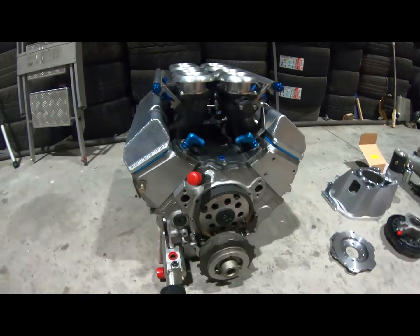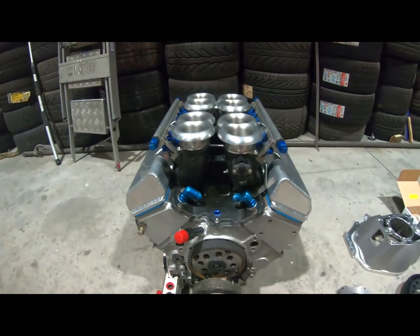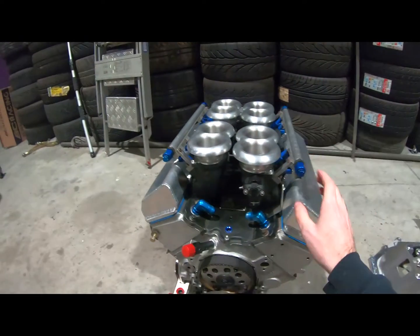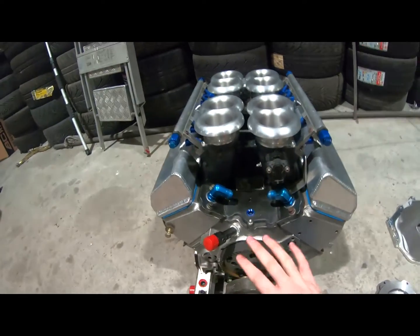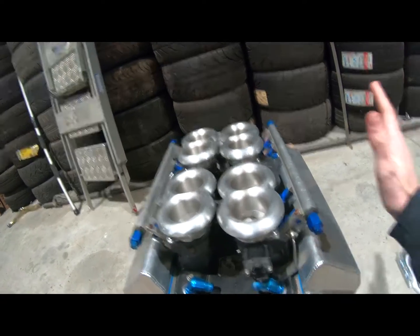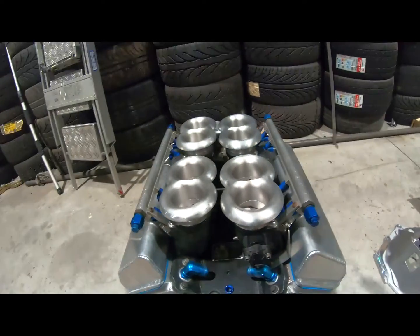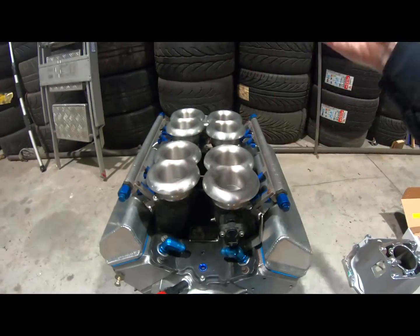This has what's called a 4/7 swap on it, which is an interesting kind of mad engine builder thing. Basically with the firing order of the V8, I think you only have maybe 3 possible firing orders on a V8. And then you get into like cross-plane cranks and stuff like that, but we won't get into that. Basically you have to fire 2 cylinders side by side at some stage in your firing order. Normally it fires them at the rear, which is the hottest part of the engine. It gets the least airflow, blah, blah, blah.